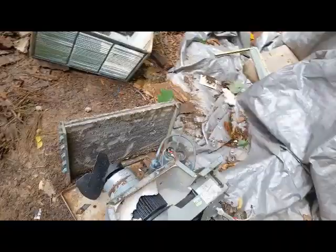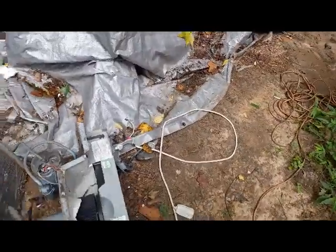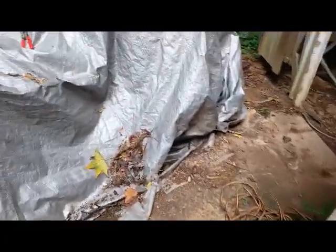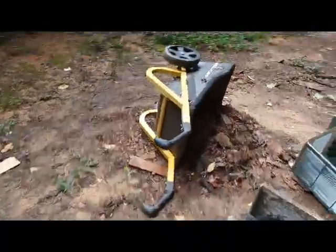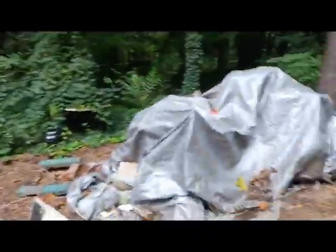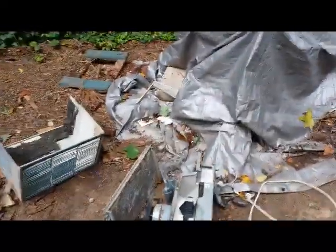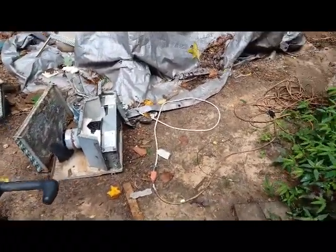Well, I think we're done playing with this — the compressor's shorted. It's kind of interesting though. I would have liked to have seen it lock up while it was running and then start drawing a ton of amps and kill everything off, but circuit breakers won't allow that. Maybe I should have taken it over to the other house where we have a Federal Pacific panel, because that would have just let me run as much current through it as I wanted and the breaker would have never tripped. Anyway, thank you for watching — I will recover the refrigerant from this.